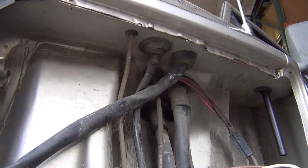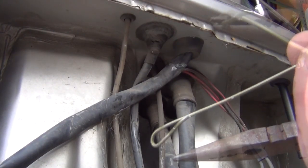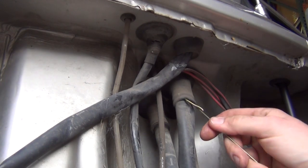With the horn grounded, move over to the driver side and locate the largest, foremost wiring loom to the right. We'll run the power wire into the van through this loom boot. Use a piece of sturdy wire — a coat hanger — hook the end and gently feed it into the boot end several inches.